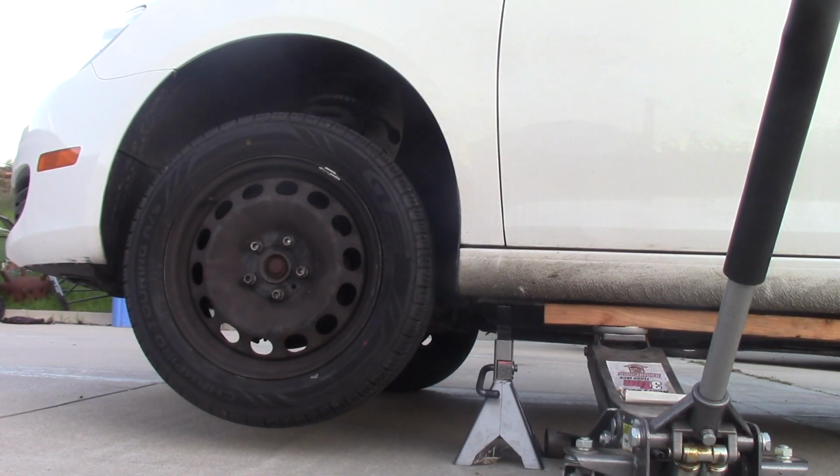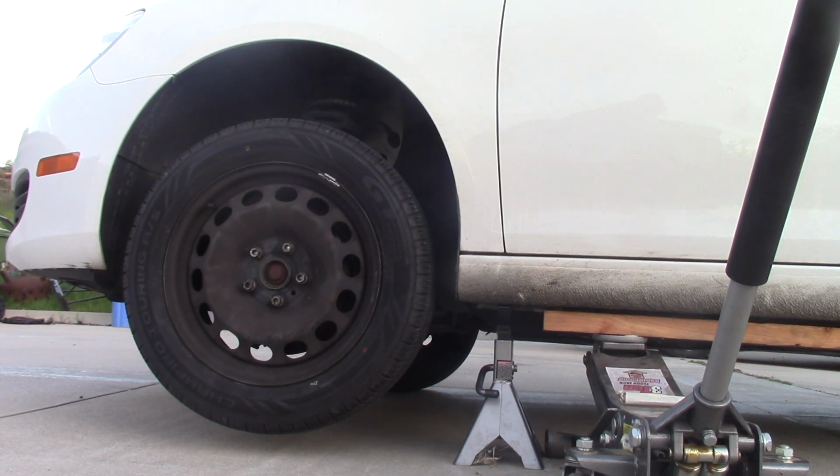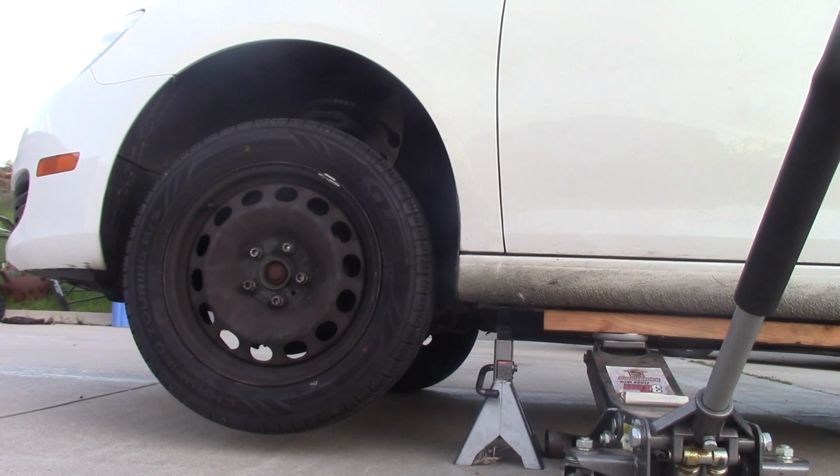The jack stand is already under the lifting point, and I showed you the lifting point previously. There's a little dent right under it. There's a double plate for this jack stand made by the manufacturer. The next step is I'm going to be lowering, releasing the pressure like so, very gently, and letting this car land on this jack stand. And as additional support, once it has landed, I will use this lifting jack again. I'm going to be adding a little bit of pressure like so. So it's still sitting on the jack stand, but it's just an extra security step. I'm keeping this lifting jack on.